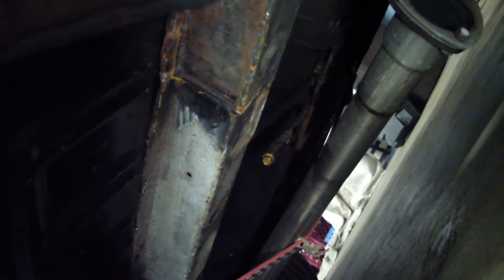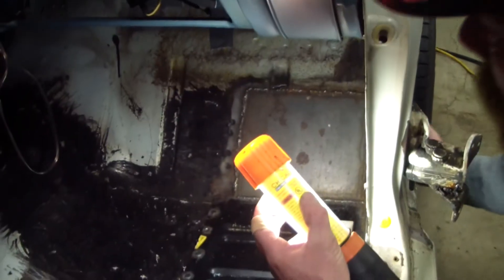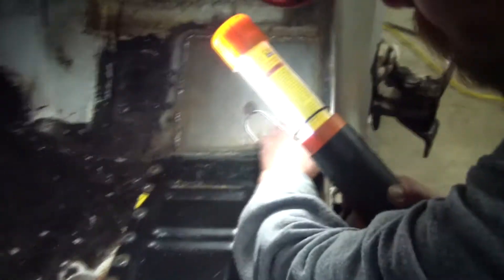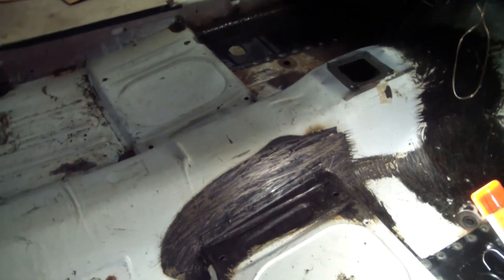The frame has been wrapped with 1/8 inch steel — this is all 1/8 inch metal, it's overkill compared to what was from the factory. As you look inside, you'll see how the thin little floor pan comes up and ties into that whole box underneath. Then the rocker panel is tied in there, and that energy goes back into the area where the seat pan is tied in with the drive shaft hump, then dips down and the same thing goes back — it's just a series of trusses going across the two rails of the rockers.